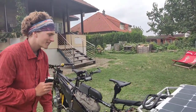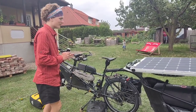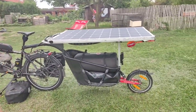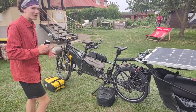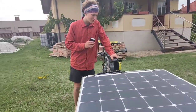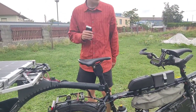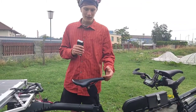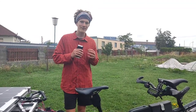The trailer is also part of the system — it takes away some of the forces from the bike and puts them on this additional third wheel, so the tandem bicycle doesn't have to carry as much. The suspension seatpost is also helpful, because the rear rider can't see bumps coming, so when a bump arrives the suspension seatpost absorbs the impact.